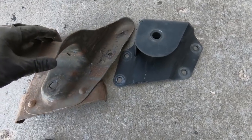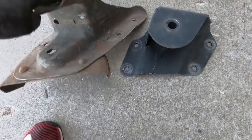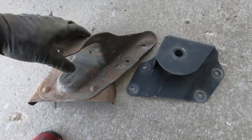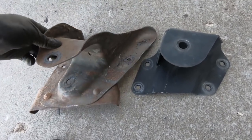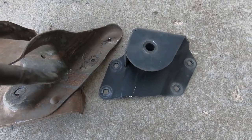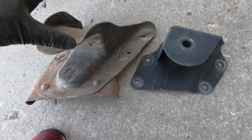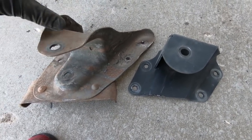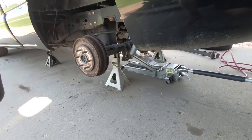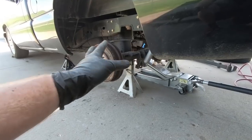I think I'm going to have to make these holes a little bigger because the bolts that came with this kit don't think will work, but that's not a huge deal. I'm not going to concern myself with bolting the bottom — I don't see any sense in it since the factory uses rivets and most of the time people just knock the rivet heads off anyway. We are ready to go back together, essentially just reversing the process. I would not recommend doing it this way if you were doing a flip kit to start with, but going from this setup to this is a little bit easier — you can literally just take the leaf springs out and put them on the bottom of the rear end.